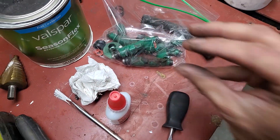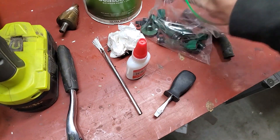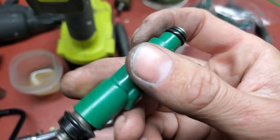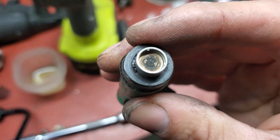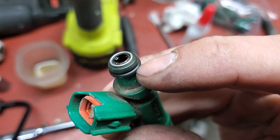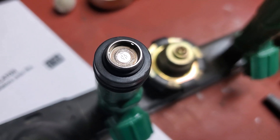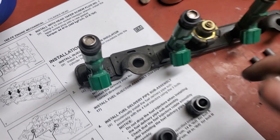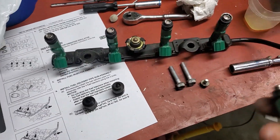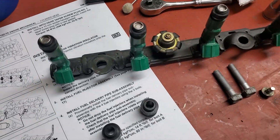I'm keeping the old ones because they are OEM and they still worked, but I wanted new ones. When they say remanufactured, they don't actually gut the inside because it's a one-cast piece - it's an electromagnet. They changed the nozzle thing on the tip, put on a new one of those, changed the ring, and changed that little insert part. On these new ones you can tell they're nice, clean, and you can actually see the holes in them. I got these for about $50 for a set of four. So unless you're going turbo and doing bigger injectors, these work great.